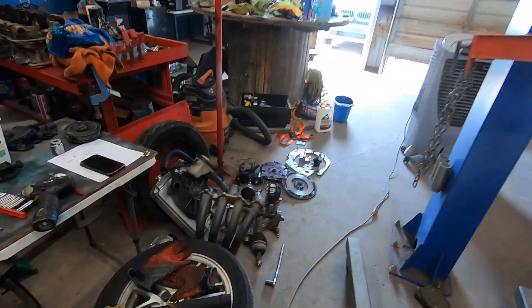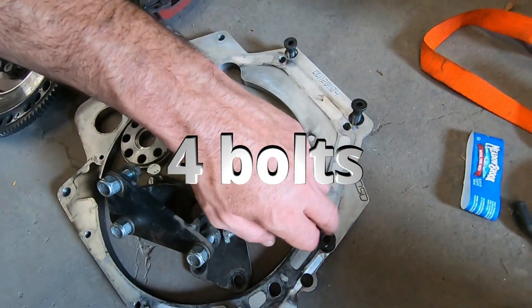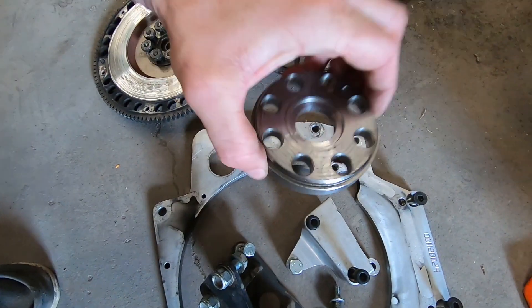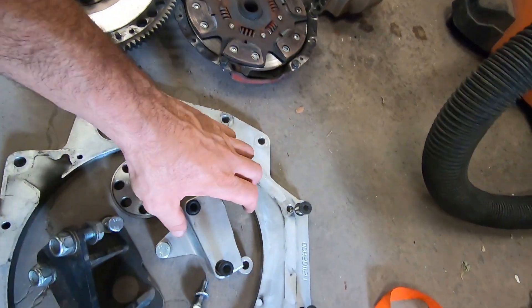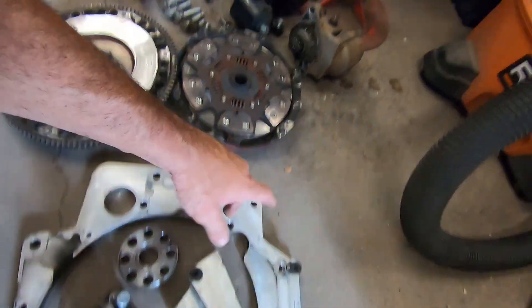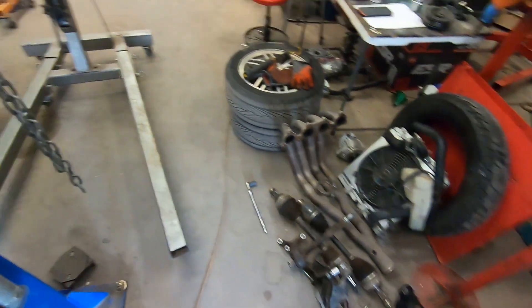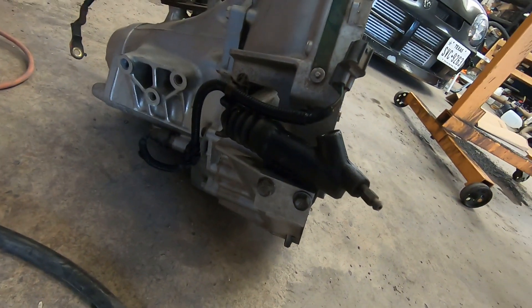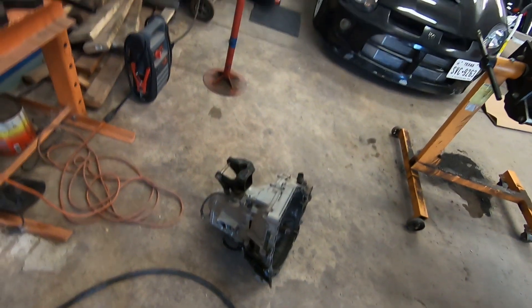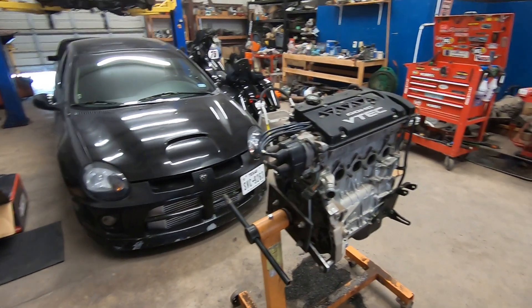I do have the H2B kit on the ground so you guys can see what it consists of. It's this bracket right here, three bolts that attach to the back of the block, you have the extender or spacer for the flywheel - you use a B-series flywheel and clutch - and also this mount here that goes for the front engine mount, and this adapter right here for the half shaft. There's also a spacer piece for the H22 slave. I'm going to take the spark plugs out real quick and see which ones are sooted pretty bad - they'll tell me which cylinders failed. I'm pretty sure it's three and four.